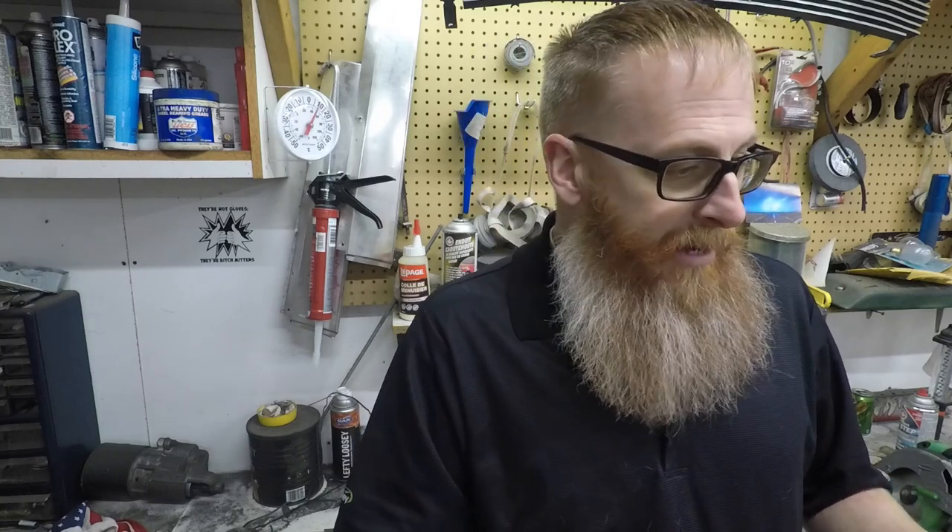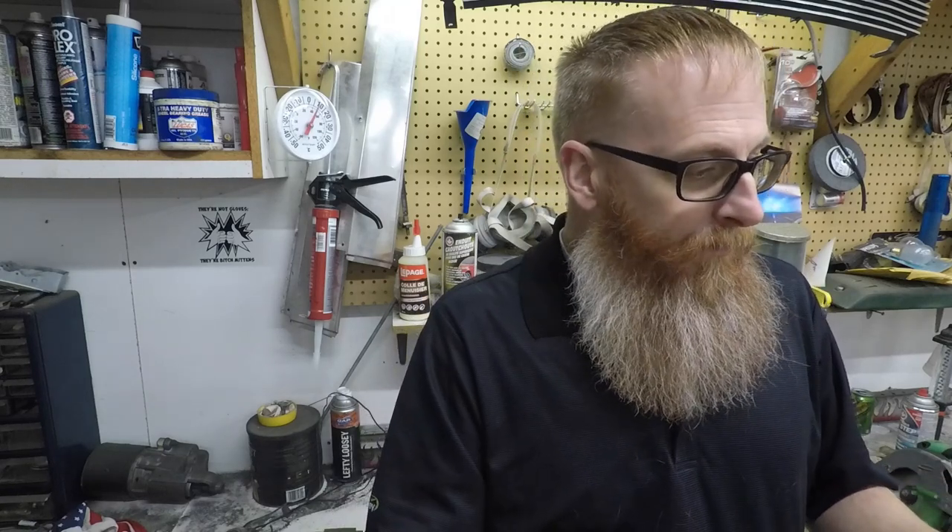The front left lower fender bolt — I took that out when I was doing some bodywork, so we've got to put that back in. Reinstall the doors — that's an obvious one. Coil springs with a question mark: once we get the box back on and the truck sitting at stock height, we'll determine whether or not we're going to take a coil out of the front coil springs to get it down lower, or maybe the way it's sitting will be just fine.